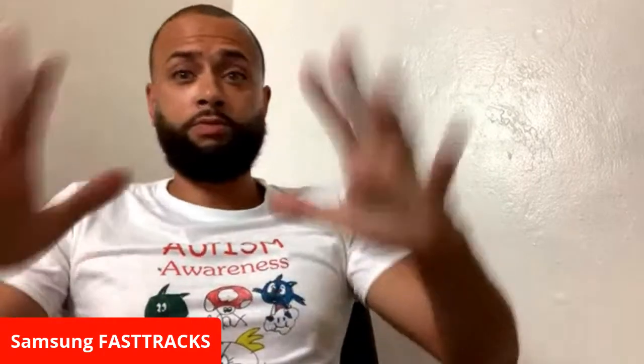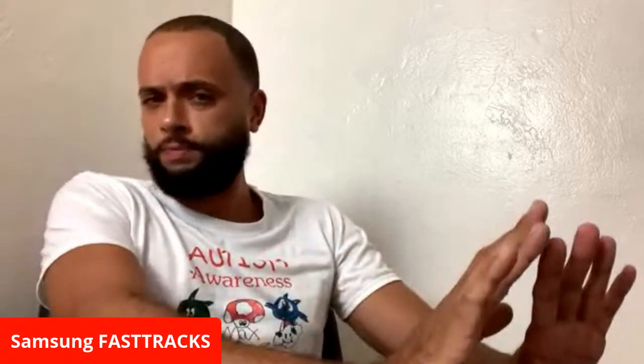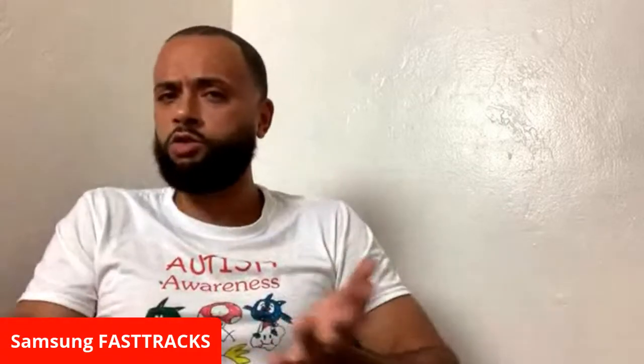That's your best friend, man. When you get into the house and the customer wants to open up the doors and start touching and showing you, whoa, it's okay. We don't need to get there yet. Just tell me what's going on, and I'll open it and take temperature readings. I'll put it in diagnostic mode, but let's keep the temperatures where they are. Let's keep the doors closed, respectfully, humbly you say it, because they're going to want to open up the door. But we're going to keep the doors closed, and you're going to listen to the customer.